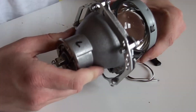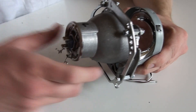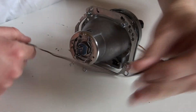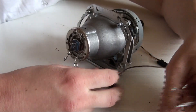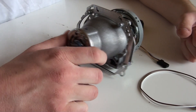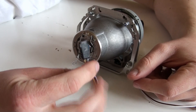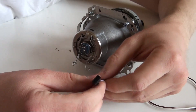That solenoid enables you to use high beams with this projector, not only with the stock high beam that is on a separate reflector with a separate bulb. If you're reworking your original H7 headlamps, all you have to do is provide this connection to your high beam bulb and it operates alongside the bulb, giving you dual high beam. If you have a xenon version of the headlamp and you're just swapping out the projectors for better ones, the original uses this MQS connector — a 3-pin one with only two connections occupied.